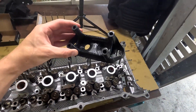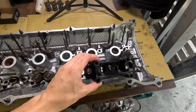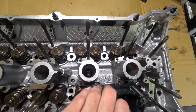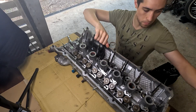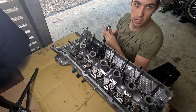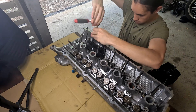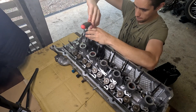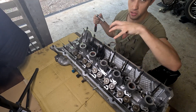So we're just going to get cracking on the head now — we've just got to remove the valves. We've got this special tool here, it's 3D printed. It'll basically slide on the studs for the cam caps and slides down onto the valves like so. Pop the bolts on and just slowly do them up evenly so it pushes the valves down even.